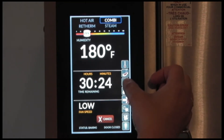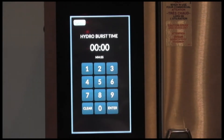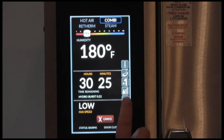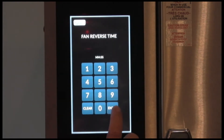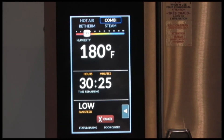You have the add a minute function which adds a minute every time you press it. You also have steam on demand which is a duration of time you set for a burst of humidity. You also have your vent key which is open or closed. You have fan delay which means you can pause the fan for a duration of time that you set. Fan reversal so that you can set that yourself as well. And then you have your light. Once the oven has reached temperature or preheated, the start key will populate.